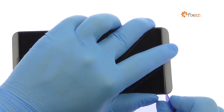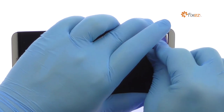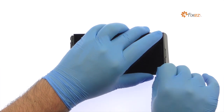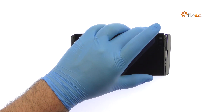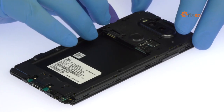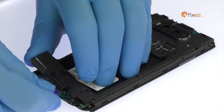With the triangle opening tool in hand, extricate the tight-fitting top and bottom metal covers. After attacking some pryable clips, pop off the LG V20 exterior mid-frame with ease.